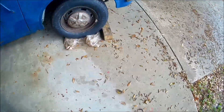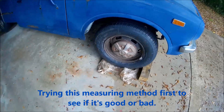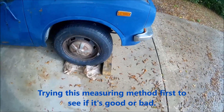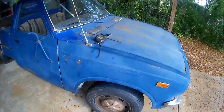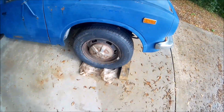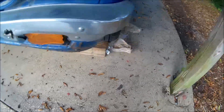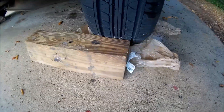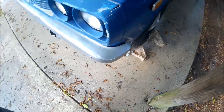This time it's a little different — I'm going to use some blocks to take measurements front and rear on the front tires. You just need a measuring tape; I've got a square just in case. Really just use the ruler to line up the blocks with the inside edge of the outermost groove.